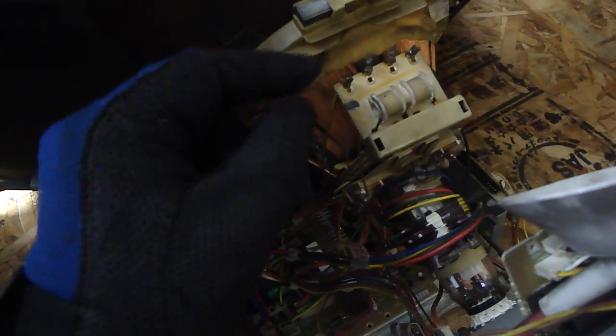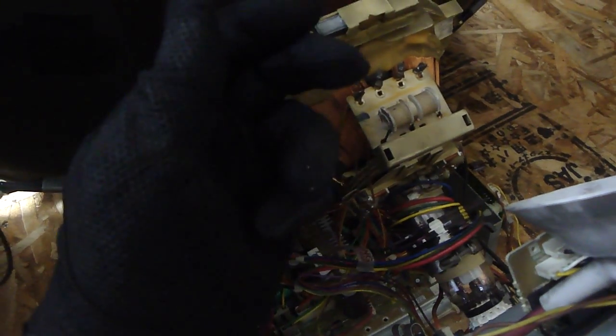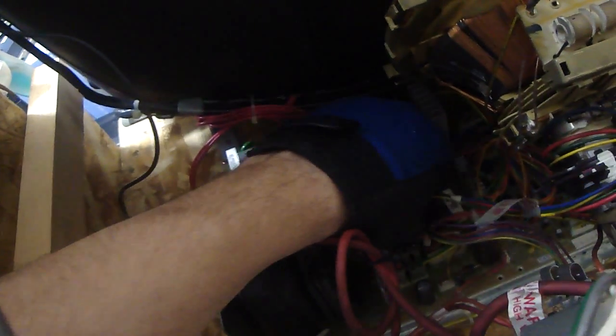Touch the clips to the side here to ground it out and make sure there's no power going through. Once you've touched it to the flyback transformer and there's no power, you're okay to change the wires. These wires are just a clip and the clip only goes in one way with this tube. Some of them are actually soldered onto the tube — if that's the case, desolder the blue and red wire if it's horizontal that's reversed, or the green and yellow wire if it's vertical, then switch them around.